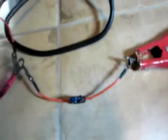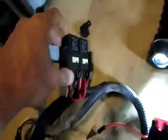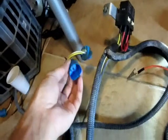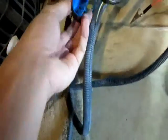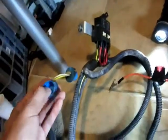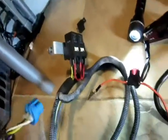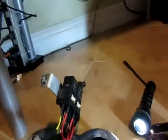We put our stock German relay back in — Mel or Meli, I don't know what it's called, but it's German and it's a relay. This is the little trigger wire piece — it connects to the stock headlight connector in the car, and that just tells the whole harness what to trigger. It's getting power directly from the battery, but it knows when to trigger the relays by getting voltage from the stock headlight connector. When the low beams or high beams are on, it triggers one or two of the relays. They actually make one of these with four relays, which is better because each filament has its own relay instead of just high beams and low beams sharing.